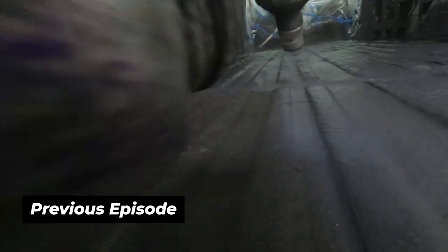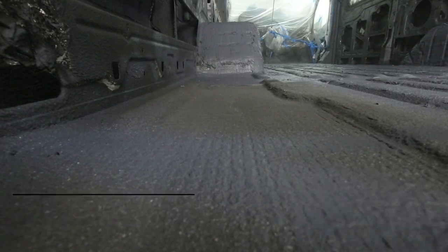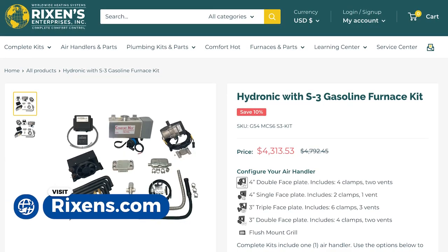When you heat the floor itself, the lining of the van, the actual surface of the van, is warm, so that if you do open this door and all of the air escapes out, by the time you close that door, the surfaces of the van will work towards rewarming that van. I've also obviously coated the floor with a thermal barrier from Lizard Skin, and I'm using some real high-tech materials that will make up the floor that will also help to direct the heat and also retain the heat inside the floor. The system that I'm going to be having is a hydronic system.